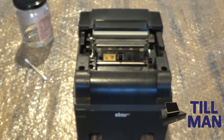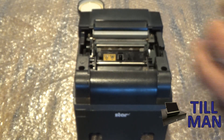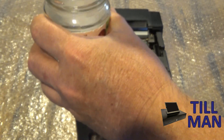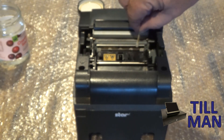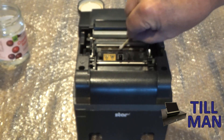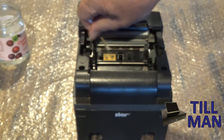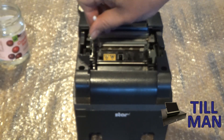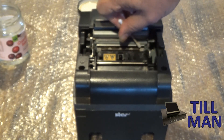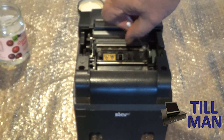There are a couple of things you can do to darken up the print. The first thing you want to do is clean the thermal head. Get yourself some isopropyl alcohol — you can get that from the chemist. Dip your cotton bud into the alcohol, just tap off the excess; you don't need the thing swimming in isopropyl alcohol so it drips down inside the printer. Wipe along this line here — see that black line along the back there — and that whole section underneath it. What happens is the paper gets burnt against this and as it's rubbing along there you end up with a coating of burnt paper dust, so you want to clean that off first. That's the most important thing.